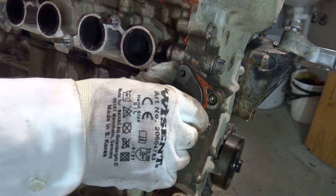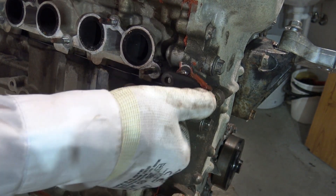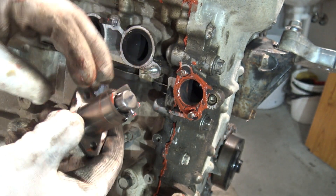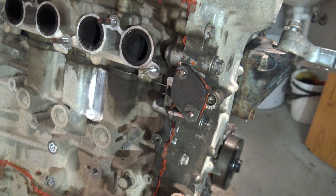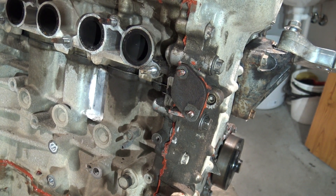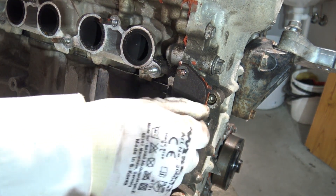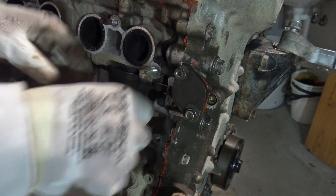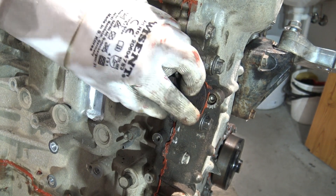Tensioner installation back — remember it goes in only one way. When I install it wrongly it doesn't go, then I rotate it and it goes nicely in this position. Good. Now I need to install it here and the torque is 10 Newton meters for these nuts.